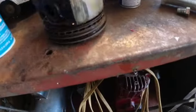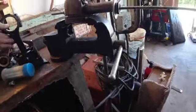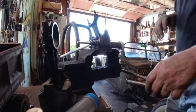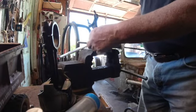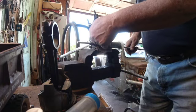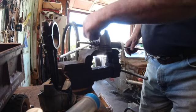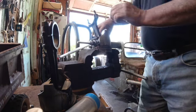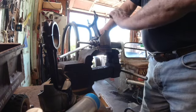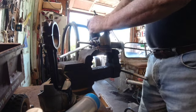The way you do that is you put a threaded rod through it and lock one end so that it will not turn. Then you put a washer on here that's the size of the pin that will pass through the piston, then an extra big washer and a big nut for extra spacing, and another nut on the other end. By turning that nut you are slowly pulling that pin out.